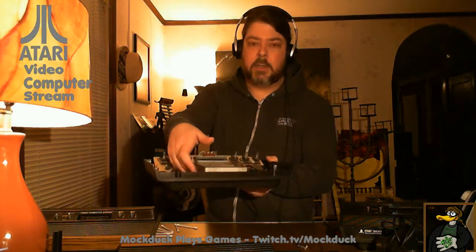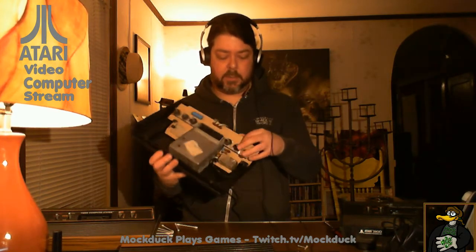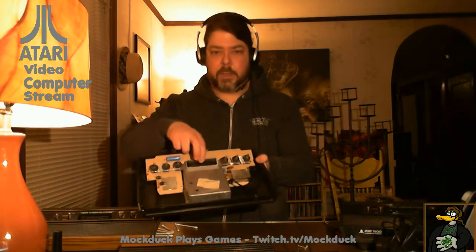This is the basic RF shielding — inside this metal box is where all the circuit boards, memory, ROM, all that lies. Here are your switches: if one doesn't work, you can unsolder and resolder in a new one. Get in there with a thin makeup brush to decrud the inside. You can also take a cart, put a bunch of rubbing alcohol on it, and work it back and forth to clean out some of the gunk. They do sell retro gaming cleaning kits for this — almost like little credit cards — but you don't need them.